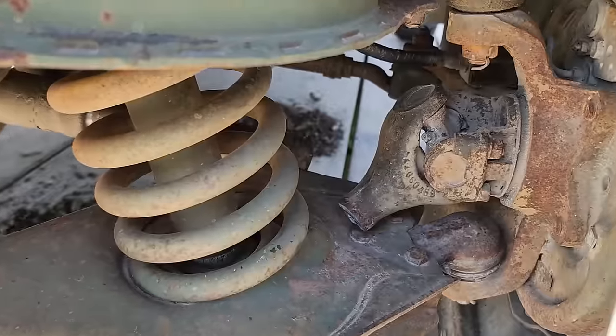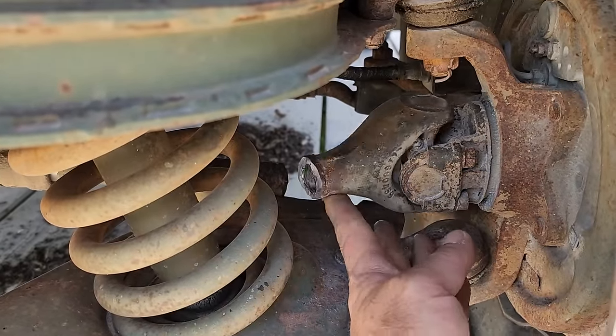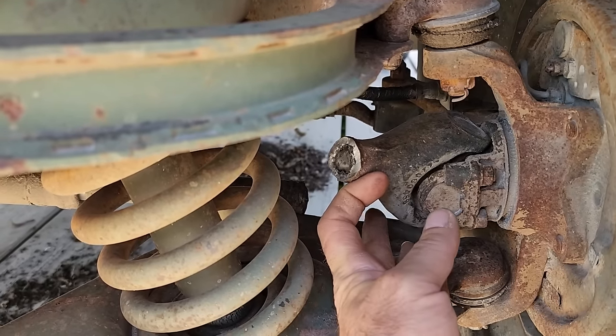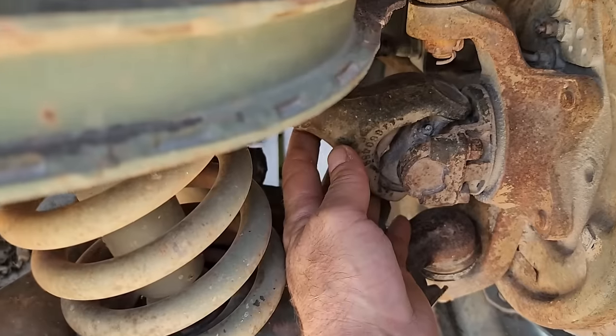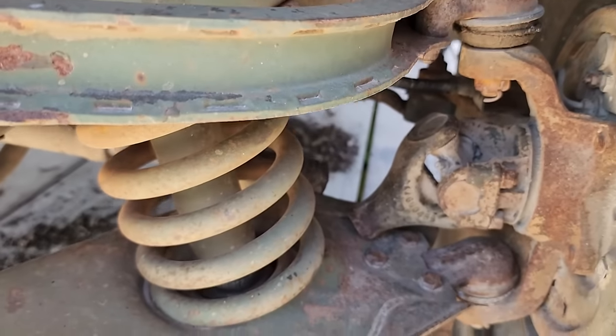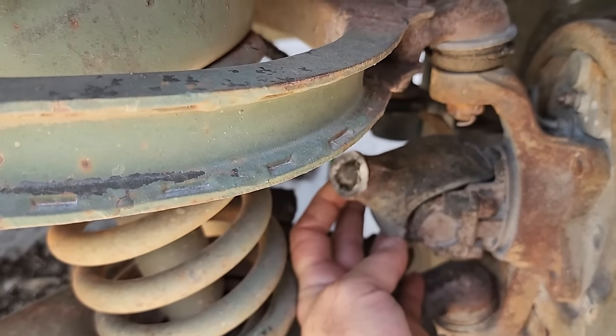But on the way home at a gas stop, I noticed this. That is what let go and allowed the front end to turn. Not terribly beefy. So you wouldn't really want to go crazy with the engine swapping something into this. Look at them, the U-joints are kind of small. So that's probably where I'll just stick with a four-cylinder engine if I do swap it. I should be able to clean that up and re-weld it.